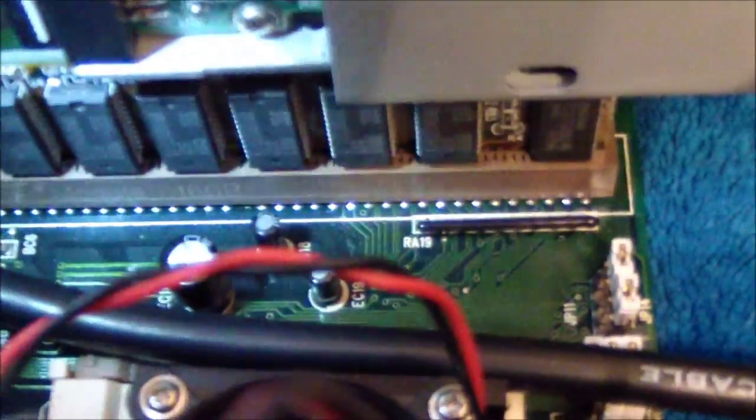There is the Coast module. It's brown. It almost looks like a VLB slot at first, but it's not. That is the L2 cache Coast slot, and it actually works. If you find the correct module, it will work. And this board is actually pretty speedy with the 256 KB. I'm trying to get a shot of the back, but that's not working out.